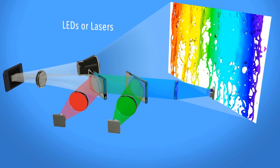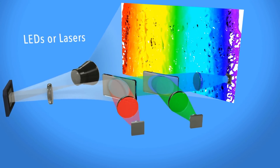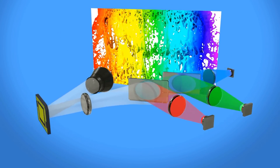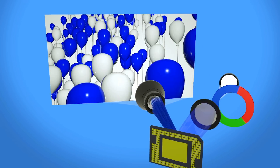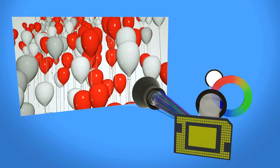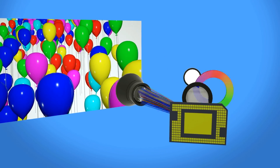If you want to be persnickety about it, projectors actually have three DLP chips — one each for red, green, and blue. Back before this was affordable, projectors spun a color wheel in front of a lamp and displayed each frame one color at a time. For most people, persistence of vision would sort it out, unless you could see the individual flickering colors, which was highly irritating. Leave a comment if you too remember the obnoxious rainbow projector effect.